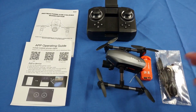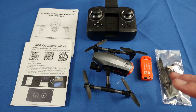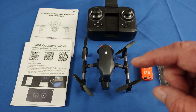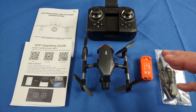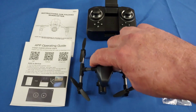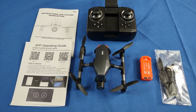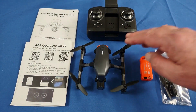The video is recorded onto your phone. The FPV video can be viewed and recorded onto your phone using the Wi-Fi UAV app available on Play and on the App Store. And with that app, it records that 480p and electronically enlarges it to 1080p at 24 frames per second on your phone. And the still photos are frame grabs of that video at 480p, again electronically enlarged up to 8K. What is the advantage of doing that? None. It still is going to look like a 480p video or a 480p still photo.